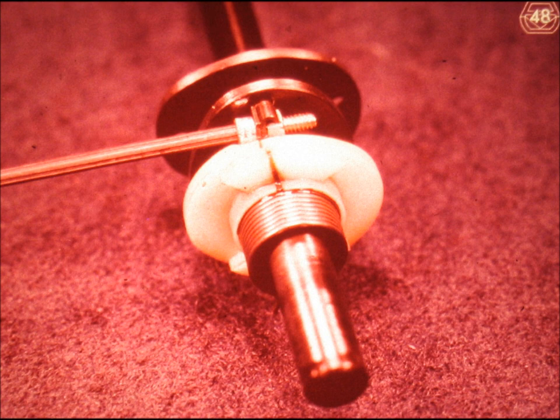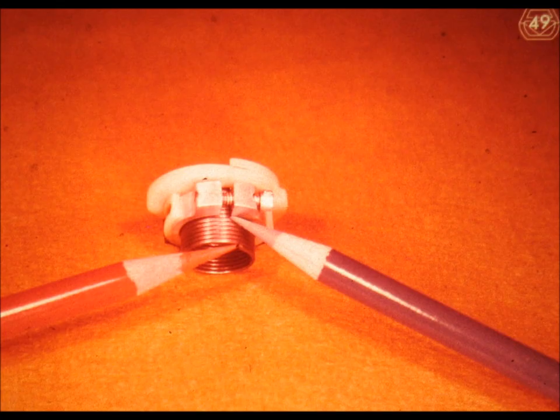Let us now take the clutch apart by loosening the cycle clutch clamp, as shown here. If you're working with a level 1 machine, notice that the left end of the cycle clutch spring, indicated by the red pencil, is positioned into the slot indicated by the blue pencil. Needless to say, that is where it goes when you reassemble the mechanism.